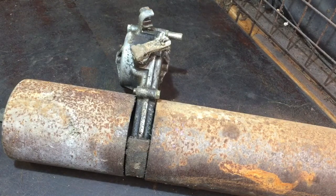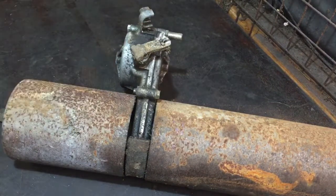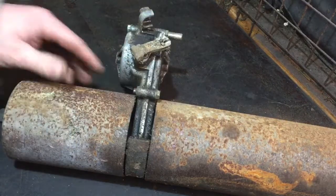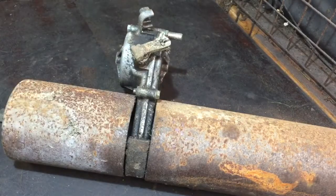The only thing I'm really bothered about is that when I push the lever in, it doesn't judder before it starts to drive. That is a common problem on these Hondas — all the models that have this sort of system. A lot of them I've had the judder in, and usually it's that dog clutch that causes it. But this one visually looks okay — it doesn't look like it's dug in and it seems to be moving freely. I've held that in and turned it and it does drive, but you can't tell whether it judders because you need the engine speed.